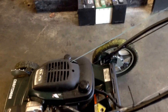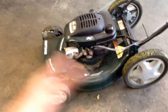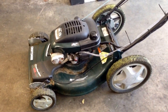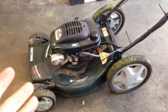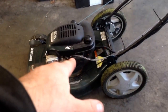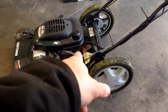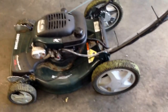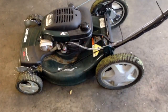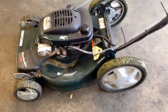The reason I did this is it virtually stops the need for oil changes. This is dual fuel by the way — you can put unleaded fuel in it and run it, you just can't run the propane unless you pinch off the fuel line. If you put a little C-clamp on there to pinch it off, then just run the carb out of fuel, you can switch over to propane.